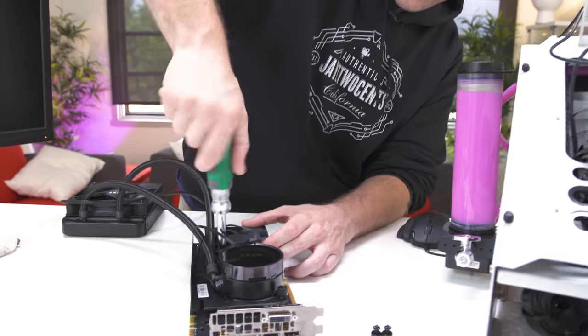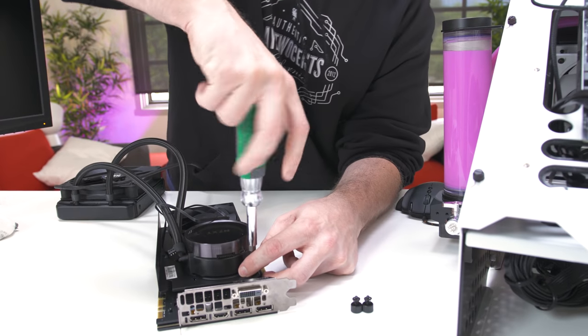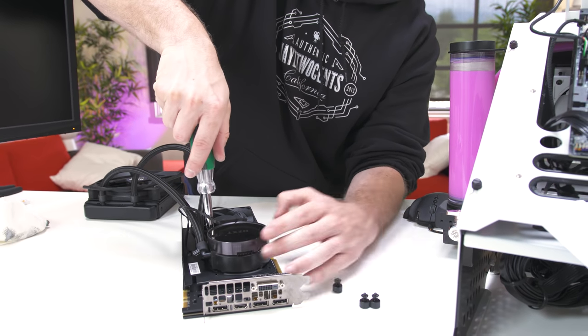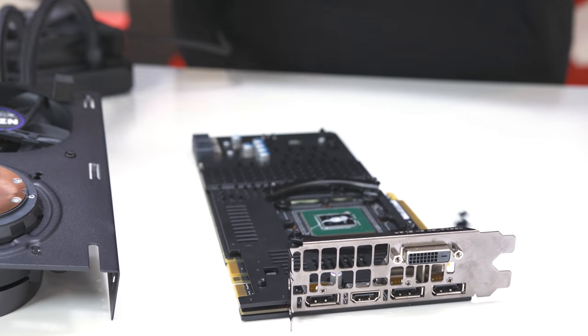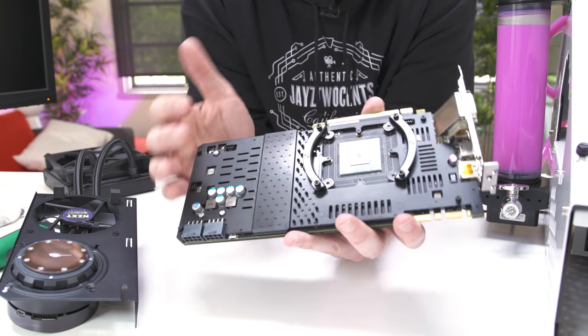So clearly what we were seeing was the GPU basically overheating. With just the two screws tightened all the way down, we're still not getting any spread of thermal paste on there. The only option now is to take the face plate and back plate off. If I had my Dremel here I could have Dremeled out the corners. The good news is I didn't kill it — I was afraid I might've killed it by forcing it to turn on repeatedly when it was getting zero cooling.